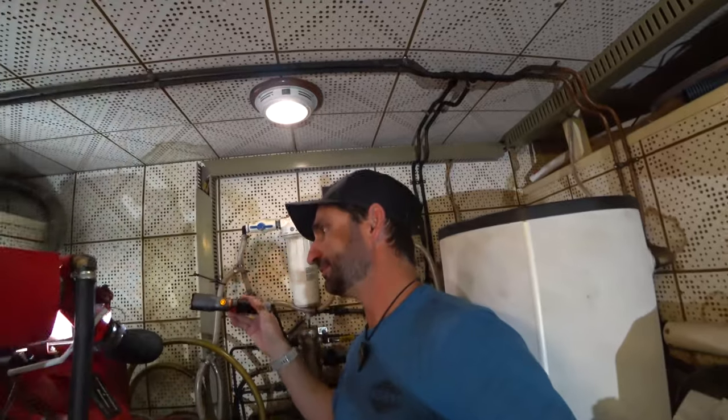You've got to make sure it goes on flush and is not off-kilter, because what happened to me was I binded up the fan when putting those bolts back together and broke the fan. So not only did I have to have the voltage regulator fixed, I also had to have that fan replaced. Just make sure as you are tightening those bolts, it's going on evenly so you don't have any issues like that. Once you've got it all put back together, put your wires back on and you should be good to go.